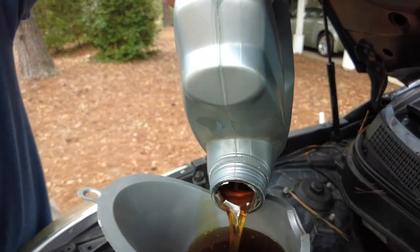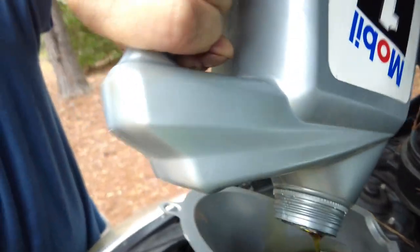Wipe my hands off a little bit so I don't get too much oil on the camera. The next step is to put the oil in. You can see the oil going in is a lot lighter than the oil going out. Five quarts. This car burns about a quart of oil every 3,000 miles or so. I'll change the oil, set the mileage, and then around 3,000 miles I'll check it again. Normally I put some oil in it, so I'm not worried if it's a little bit over full because it's going to come back out.